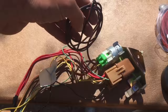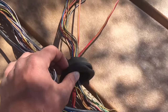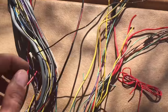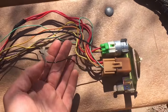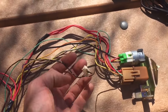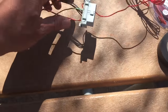We have the fuel pump positive lead, which goes from the fuel pump relay — this green connector. I'm going to uncoil this and snake it through the grommet so that it goes into the engine bay with all the other engine bay connectors. Here it is — the fuel pump wire just goes right through the grommet and we have a label there. With the relays, we just take the ground and solder it in, with a masking tape flag so I don't miss it.